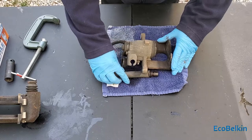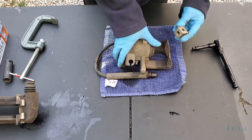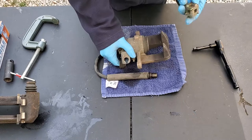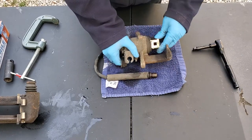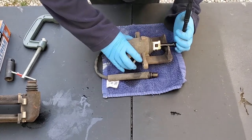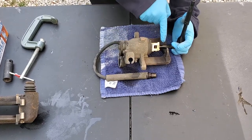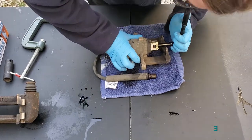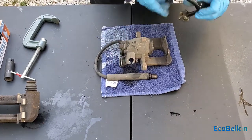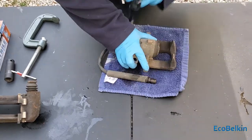There are a couple of tools you can use. The cheapest one is this little cube. You pick whichever side is going to fit the piston face — I believe it's this side — and you put it right there. Then you get your ratchet with an extension and ratchet it back in place. The problem is you have to push and rotate at the same time, and this piece likes to slip out of the grooves, so from my experience I don't like it.